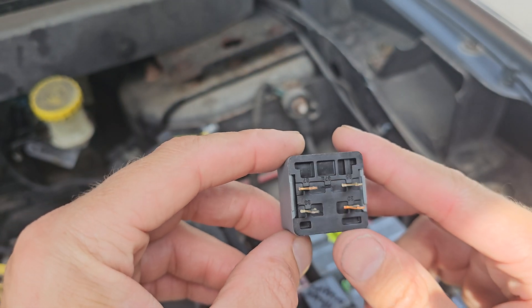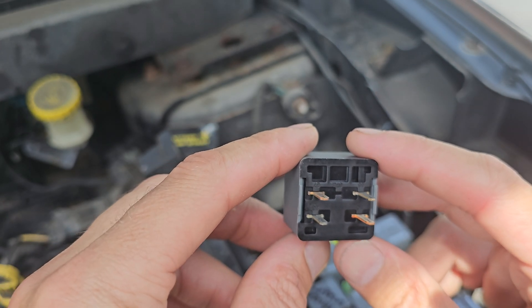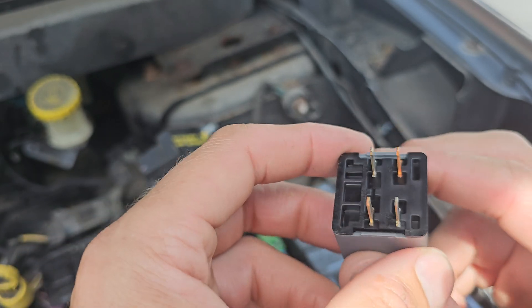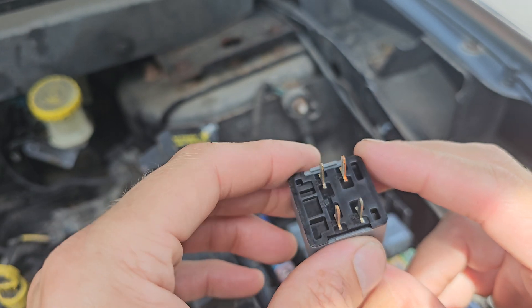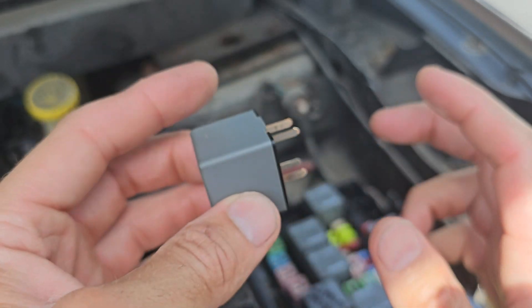It's corroded — you can see it's corroded. I'm going to test it with a multimeter. It should have 150 or more; if it has less than that, this relay is bad. Hopefully it's the relay and not the PCM — I'll be very happy if it's not the PCM.